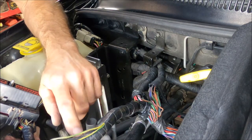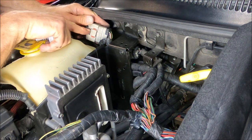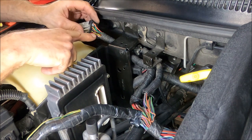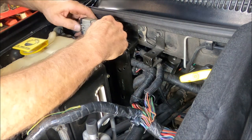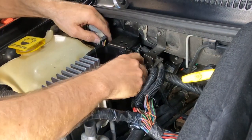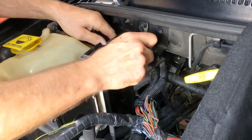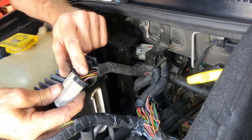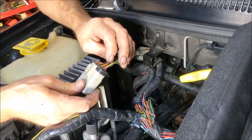If you're wondering where the other end of this yellow-green wire is, it goes right here to this gray connector, and it is in the number eight terminal on that gray connector. I can see it right here — yellow with the green stripe. You could get to it from this end. Slide the red locking tab down, push the tab right here, and pull the connectors apart. This is almost easier, and you deal with a lot fewer wires — only 13 wires going to this connector.